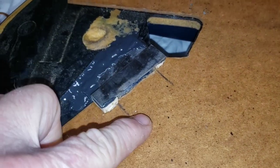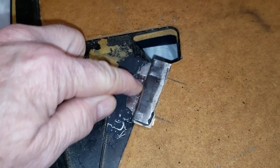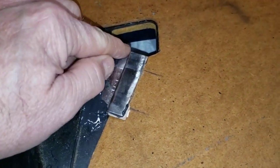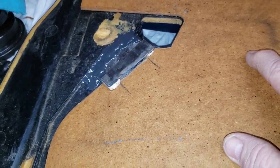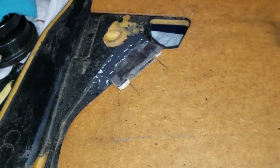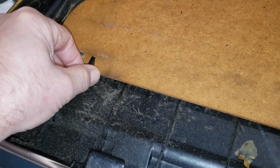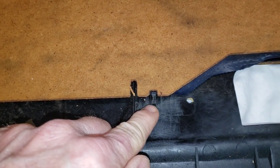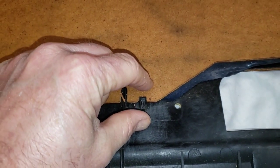This is medium density fiberboard, so I have JB Weld underneath this metal flange between the metal and the plastic, and around it as well. The idea being that if you wanted to remove this someday, it should slip right out. Also need to fix this little area - one of these hooks is broken off. I'm going to do something similar: bend a piece of metal at 90 degrees and recreate a hook right here.